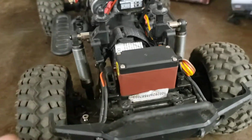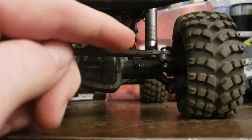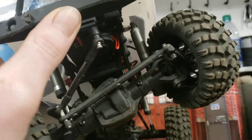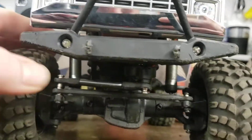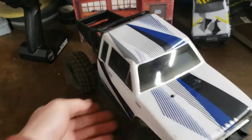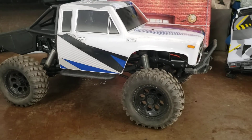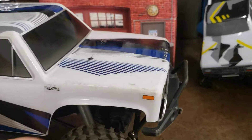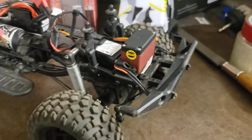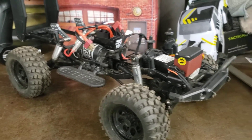This is also not the stock servo. I found the stock servo was insufficient, especially with the servo saver, which is a common grievance with this unit — the servo saver takes a lot of the fun out of it, especially when you get into some stuff when you're crawling with some of the bigger trucks and you want to go out into bigger terrain. You definitely get the steering pinched in a lot of different scenarios. This servo is out of a Gen 7 Red Cat and it is a huge, huge upgrade. Steering servo is definitely something you want to do.